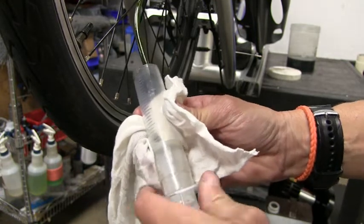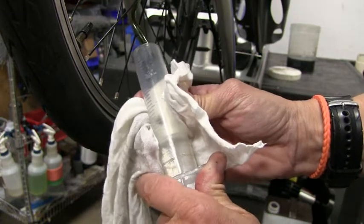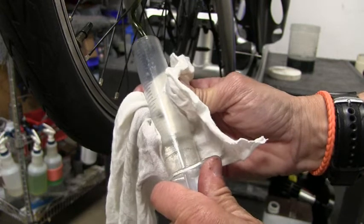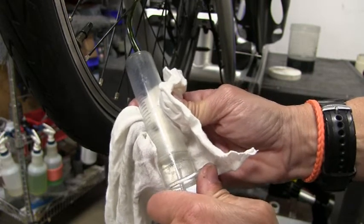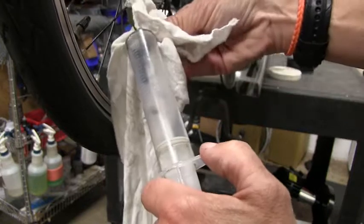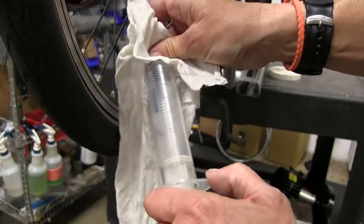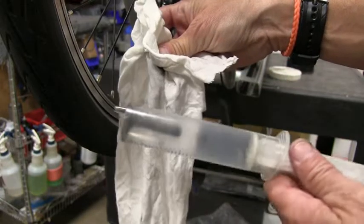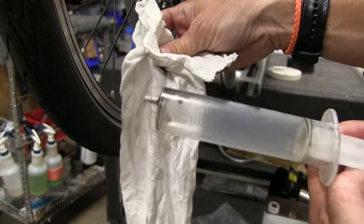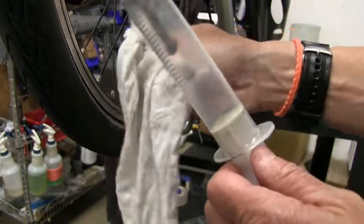This hub did not have much oil left. It's past its original break-in date, which is 630 miles on a new hub, and then about 2,700 to 3,000 miles thereafter. This oil is also pretty dirty — it's pretty black in color. So it's pretty dirty.